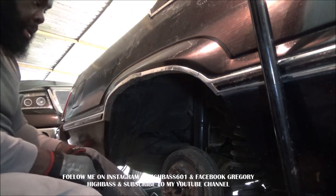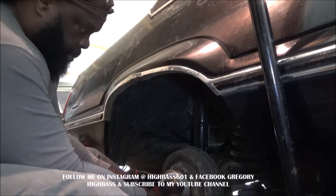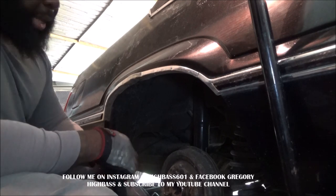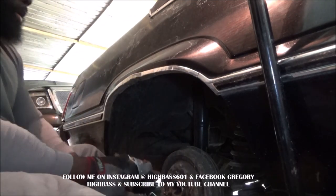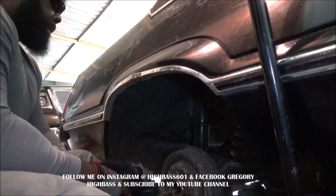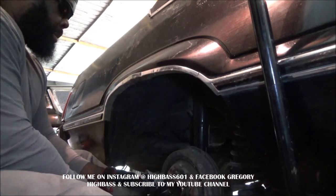All right, we're gonna see how much we took off. Took off a pretty good bit. So I gotta keep doing it until I get that spacer to go flush. I took off a pretty good bit to beat the first round. Last time I had a shorter one and it ate my grinding wheel up. When it was short, I couldn't get in there real close. So we're gonna go another three minutes. We'll be right back.